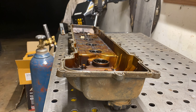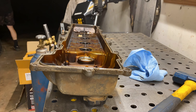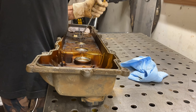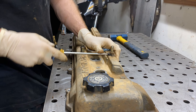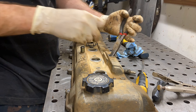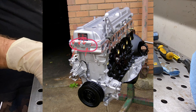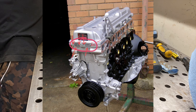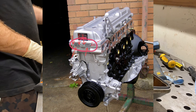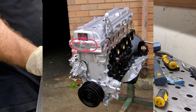Once you have the valve cover on the bench, clean it up and remove your old seals. The spark plug tube seals can be a little stubborn because they're normally dry-rotted and cracked — I'm using a flathead screwdriver and hammer to lightly get the edges to separate and pry those out. The PCV valve can also be quite stuck; I had some hard pieces stuck in there that I just pulled out with needle-nose pliers. You'll also have to pull the two metal half-moon pieces — they are reusable, just take a wire brush and clean all the RTV off of them.